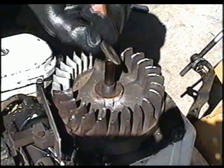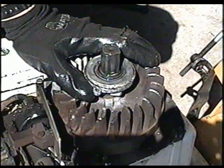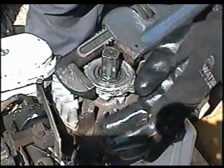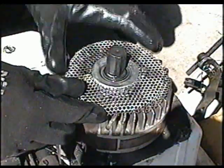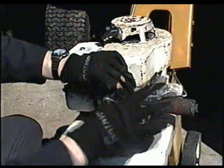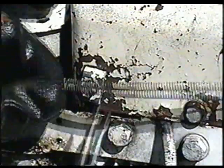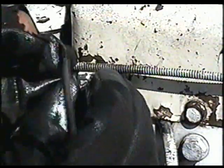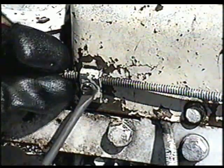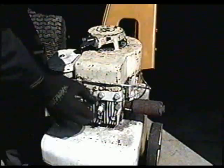Now I'm going to put this back on — don't forget there's a washer that goes there. You can put a rope in your cylinder again to lock up the engine so you can tighten this up properly. Next, you want to make sure you put the grill back on, then put the cover back on. One bolt goes over here, the other one goes back here, and the third one goes at the front down here. Your throttle cable is going to go back under the clip here — make sure you put it back in the same spot. The last thing to put in is the plug.